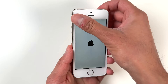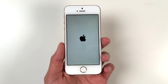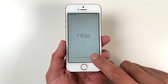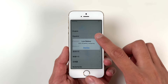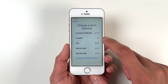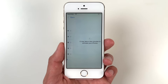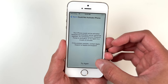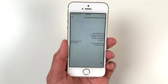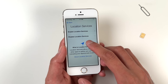Keep in mind this is the first time this phone has ever turned on as a consumer device — maybe it was tested at the factory, but this is the first time we're actually seeing it turn on many years later. We got the 'slide to set up' screen, went through setup, selected English and the US, and signed into Wi-Fi. The phone told me it wasn't able to activate itself, which was weird. I tried again and it still didn't work, but I had a feeling it had to do with the pre-installed SIM card. Once I took that out, it activated just fine.